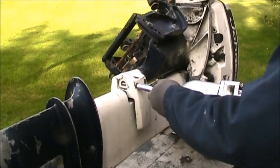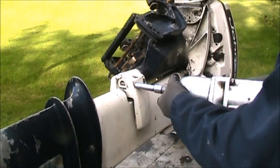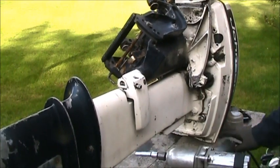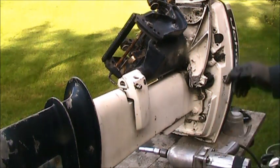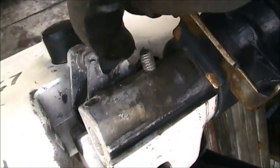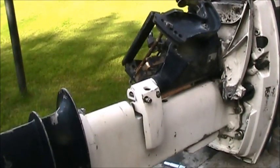Let's see. Put the Thor on. Put the Thor to him, because Thor don't play. Yeah, it's busted. One whole side of that motor mount's busted. I'll show you. See that? It's missing the little ear tab. So we have to replace that mount for sure.